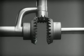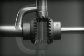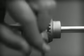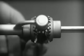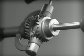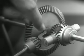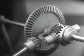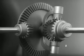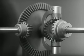Now we can make the gears thicker and stronger, and we have differential gears. The edges are cut so that they will fit together more smoothly and silently. And another gear is added to share the work of driving the axles. The principle is the same. In order to turn the support and drive the wheels, we can fasten a large gear here, connected by a smaller gear to a source of power. Notice that the power is connected to the differential at the center line.